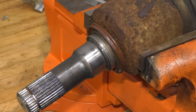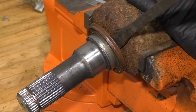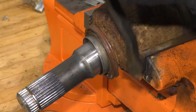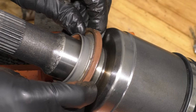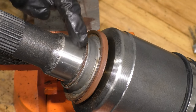When installing the new axle, if you don't have a new seal you'll have to reuse the old one — I recommend a new seal. If you have to remove the old one, be very gentle. It does come off, just watch how you pry so you don't damage it. Put even pressure on it. On the new axle, make sure you have a clean surface. If you have any debris, wipe it off, then take your seal — new or old — slide it over, and with a punch, gently drive it on, making it flush with the lip.